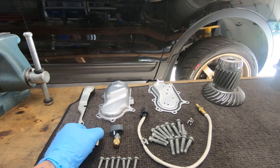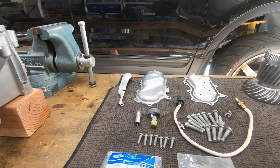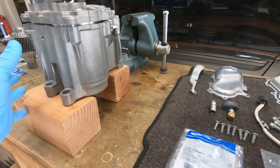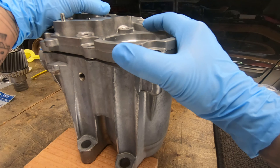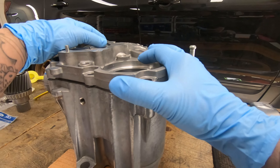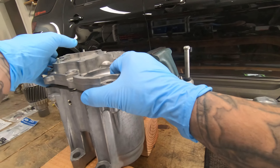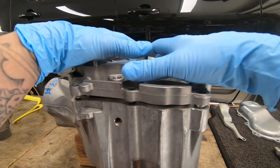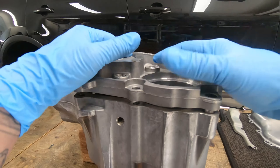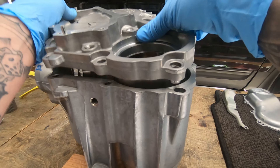The vent extension mod is very good, but it takes a long time to fill the PTU because the oil going down that vent tube is fighting with the displaced air. This is a vented case, but it's vented through the hole that you're pushing oil down. So you're essentially sealing it with the oil, and the air that's in here has to go somewhere — it's trying to go out the same hole. And it's a really small hole.